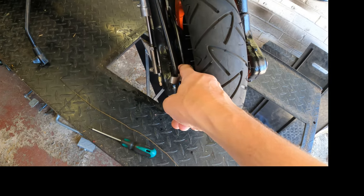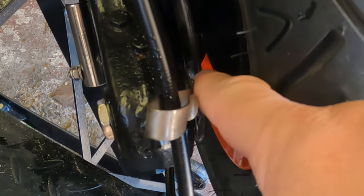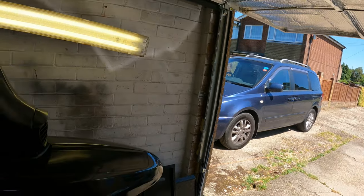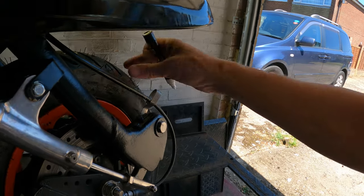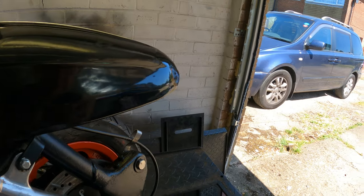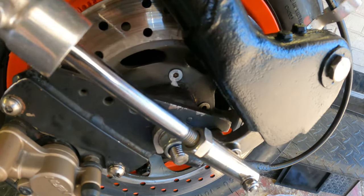Now I want to check this disc, so I'm going to use this bolt as a fixed point and do it by eye to see if I can see it oscillating — which I can. I've got a little white paint marker, always handy to have, and I'm going to put a little tiny mark on here so you can tell which bolt it is.